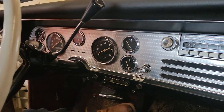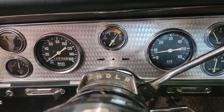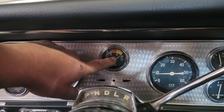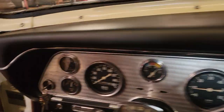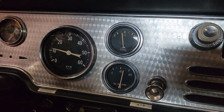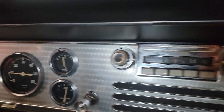Can you fire it up? Sure. It's a Powerglide — I don't know who made the transmission, to tell you the truth. We can look in the manual. It's got a real similar setup. You got your vacuum gauge and your pressure gauge — right now we're doing about 19 to 20 inches of vacuum, which is good. When you womp on it, obviously you'll get the boost pressure. She's charging — charging almost 15 amps, probably around 10 amps now. Got your oil pressure gauge working, gas gauge works, everything's working. You got a little blower whine — you can hear the volume going through, a little supercharger. Under load it probably sounds real nice.